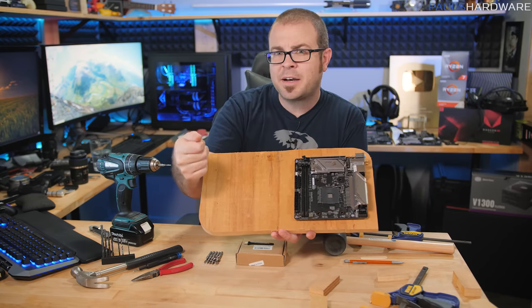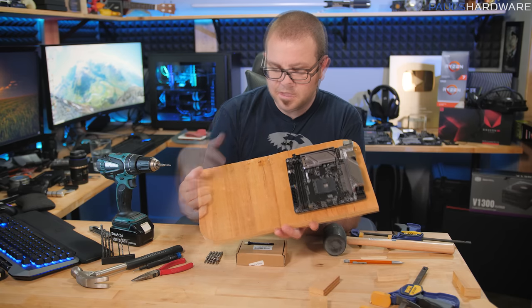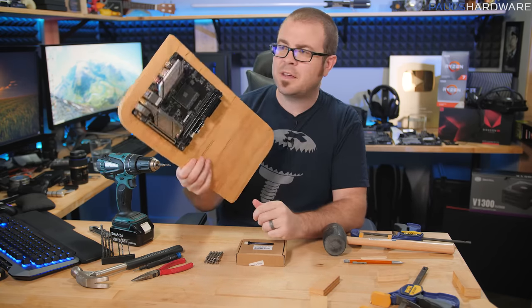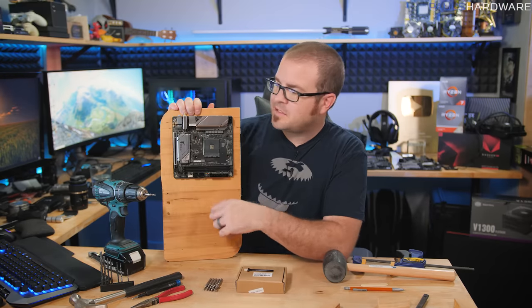If you wanted to be really sure, I think the best approach would be to use the inset standoff method and maybe just put the tiniest bit of epoxy down at the bottom to give it a little better grip and make sure it's never going to come out of that hole. But that's what I'm going to be using. For now I've got this motherboard mounted just with the tap bit screws, and I would be confident with that for long-term use in just about any scenario.